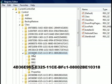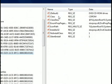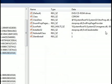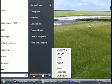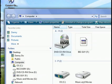I'll write that down for you guys to see — you probably already saw it on screen anyway. Once you open that folder, you're going to look for specific entries: upper filters and lower filters. They'll be in that area. Delete those, then close the registry editor, go to Start, and restart your computer. Go back to My Computer, and the drive icon will be there — everyone's happy.